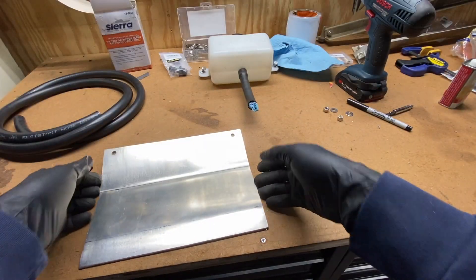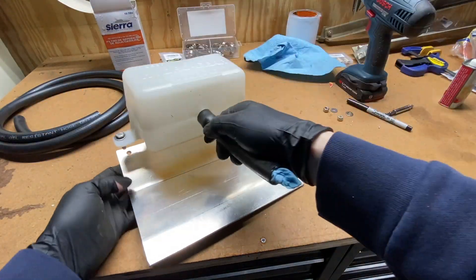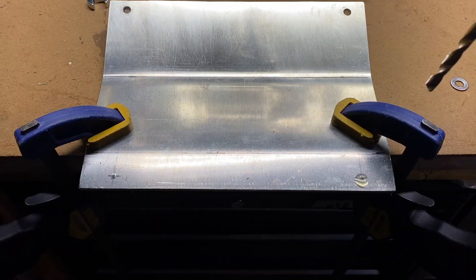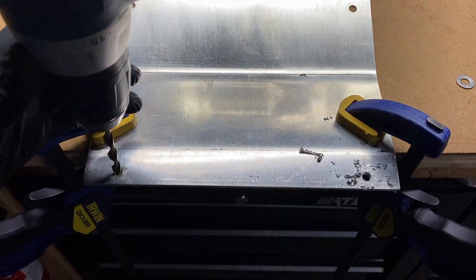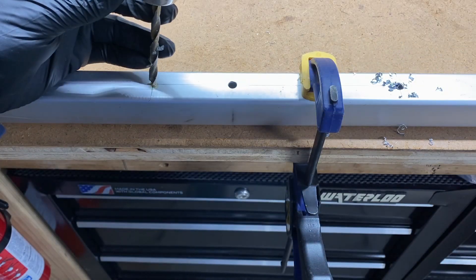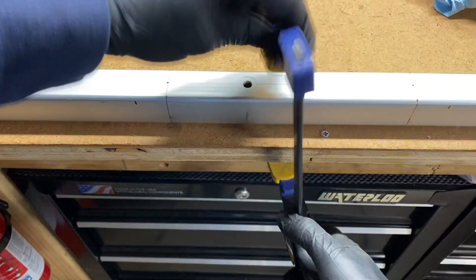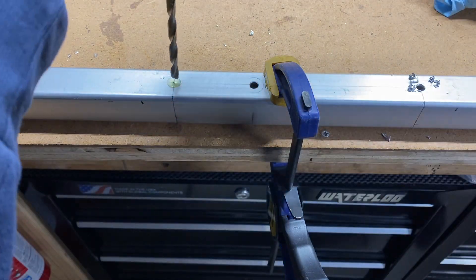Here's my adjusted aluminum sheet — the bends came out pretty well. Let's verify that the tank still fits properly. Looks good. Now let's drill the holes that will attach the mount to the mower. We also need to drill new holes in the square tube that's mounted to the mower fenders. I already measured and marked where I need to drill. I prefer to drill through the front and back of the tube separately rather than just blast through both sides in one go — I think this is more accurate assuming you've measured and marked correctly.